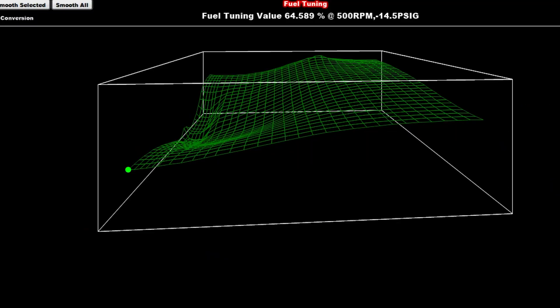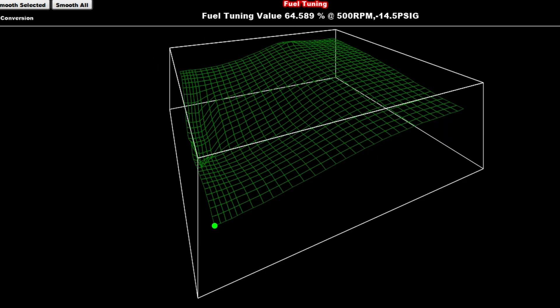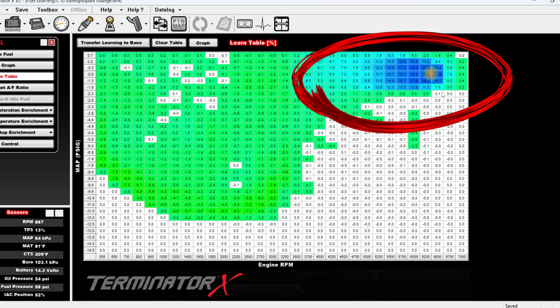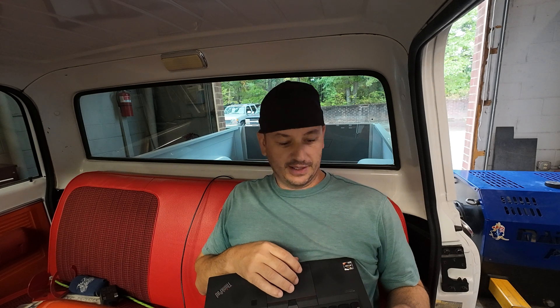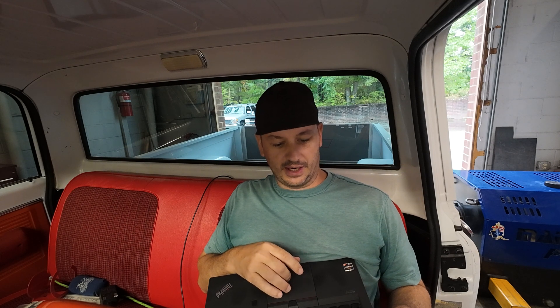Downloading. This looks like a slightly modified wizard tune. Fuel table is pulling a bunch and adding a bunch. And based off of what the learn table is showing, we're probably either going to run into an injector problem or a fuel pump problem. So that's kind of disappointing. Target air fuels need to be cleaned up a little bit, but the numbers are decent. Probably got a little bit more timing in it than what it needs. He's been driving this around for quite a while apparently, but the idle is the main concern and it looks like all the idle settings haven't been touched.